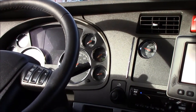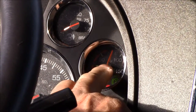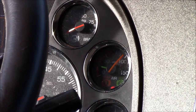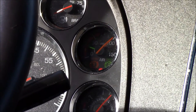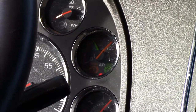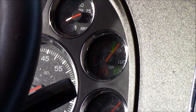The first step is to build your air pressure up until the regulator kicks in — you'll hear it release. As you can see, our air pressure is low. The orange gauge on these is the primary; the green gauge is the secondary. You can see now that the primary gauge is a little over a hundred, and the secondary gauge is starting to come up. Pretty soon you'll hear the valve release the pressure.